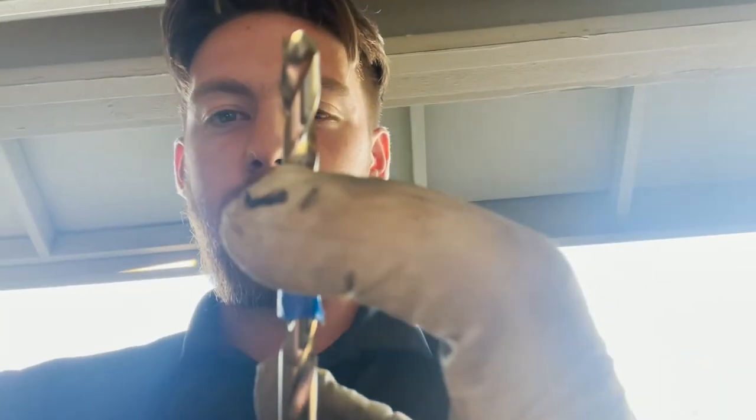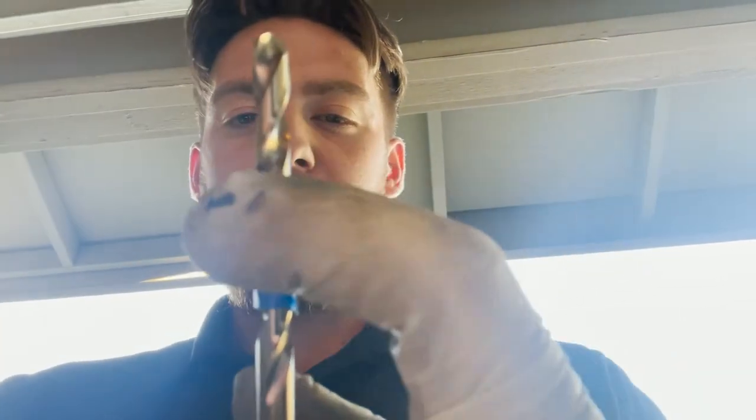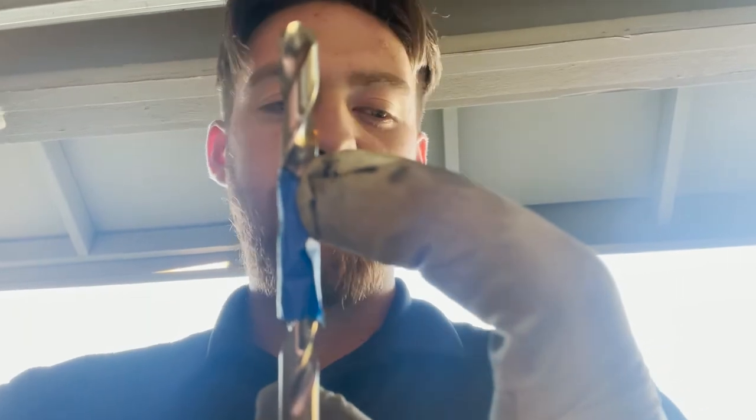What I did was measure from the surface and put a piece of tape on the drill bit so you know where to stop — you don't want to drill too deep. I aimed closer to 25mm to be safe. Once the hole is drilled, you need an M8 tap. I wasn't able to finish tonight because I needed to go get taps, so we'll get to drilling and come back for the tapping.